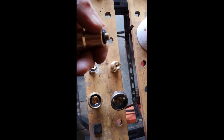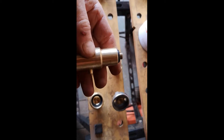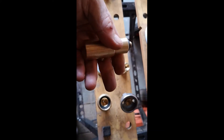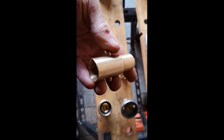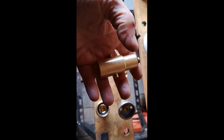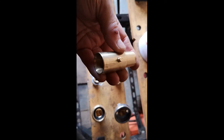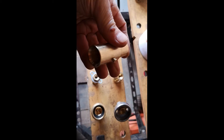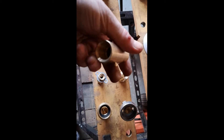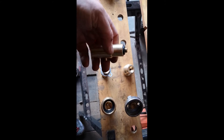The adapter threads are a little bit short, and being brass they're quite susceptible to snapping, because the filler nozzle at the station is heavy and must be supported when in place. At Shell service stations you have to rotate the nozzle an eighth of a turn anti-clockwise — which is the undoing direction on a conventional thread. So if the adapter isn't tight enough, that rotation will loosen it. Moral of the story: when you fit your adapter, make sure it's nice and tight against the filler port.